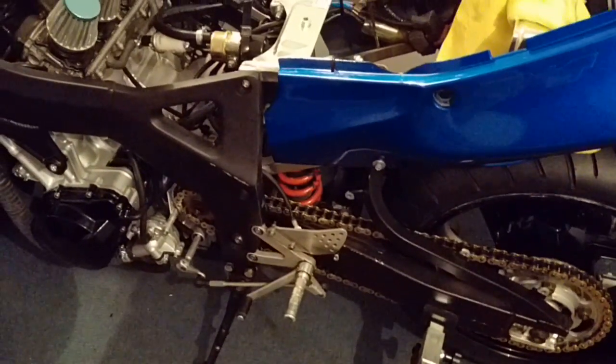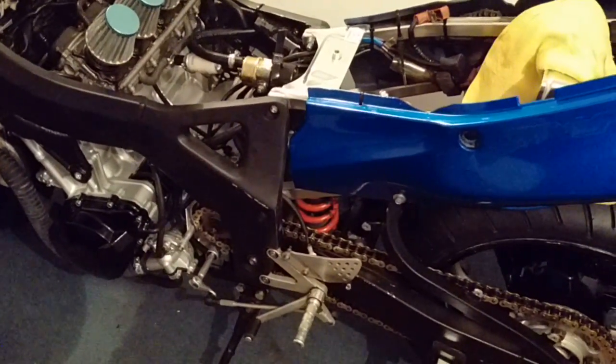Today I've been working on the cooling system. I basically had to redo it because it was leaking from the water joint — when I put the antifreeze in last weekend it just trickled out the bottom. I went and got an O-ring from Honda, stripped out the whole cooling system, took the radiator off, took all the hoses off, took the water joint off, cleaned it all up, put the O-ring in, and put everything back together.